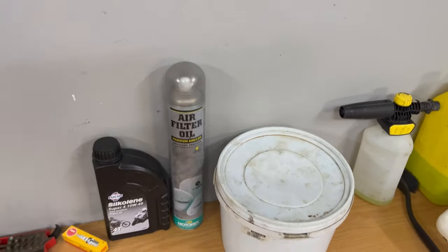I'm obviously not a professional mechanic - I just wrench on my own dirt bikes and I do not claim to know everything. But this is in general something you can apply to any dirt bike service, because it's the same thing regardless of the brand: clean your bike, clean your filter, change the spark plug, drain the oil and put fresh oil in. That's for four-strokes; for two-strokes it's pretty much the same as well. I hope this video can help you guys out - let's jump into the actual work.